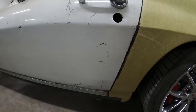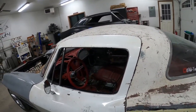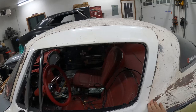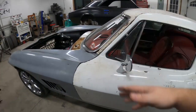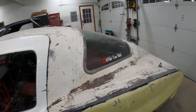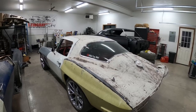The door gap is basically perfect, the body line lines up nicely, it just flows with the door really well. This is a really nice coupe — the way the doors fit across the top and through the side. If you're doing a car like this and putting one together, if you get the door to line up with the roof, then you can make the quarter line up with the door, and then you can do the same to the front end. I'm really happy with the way this looks. It's kind of crazy to see it without all the patina, but it's on its way to getting a new paint job. This will be pretty much it for Overkill for quite a while. If you enjoyed, please give it a thumbs up and don't forget to subscribe. It's the last time we're going to see this old girl for a long time — now it's time to jump into some more projects.